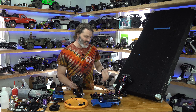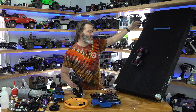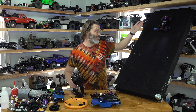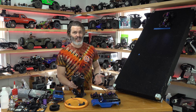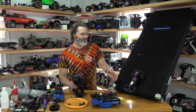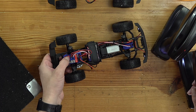It's slightly inconsistent. It also has a double tap reverse, so let's go forwards — I gave it some reverse throttle and it started going faster in the roll mode, probably because it doesn't have what I guess would be called synchronous rectification or active drag brake mode. We'll deal with that in the future more. At any rate, I don't like Mode 2. That's the stock mode.